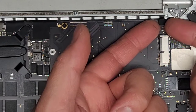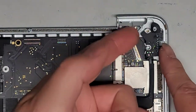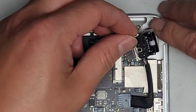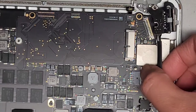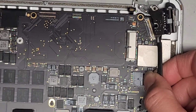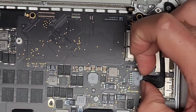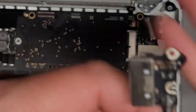Let's pop this out — this is the keyboard backlight connector. Get underneath there and lift that up. Then we've got the charge port here, the MagSafe port. These are all T5 or Torx 5 screws. Get those two screws out, then lift this back up from the back slightly and slide it back. We're going to lift this — there's an adhesive here, but it didn't stick very well. Pull this out — grab the plastic piece if you can, or get as close to the connector as possible, holding the wires flat, and wiggle it out. There's the MagSafe charger port. This model is 820-3584-A.